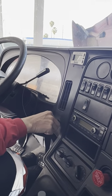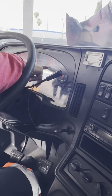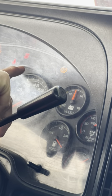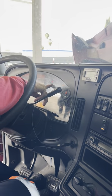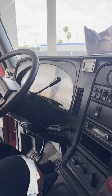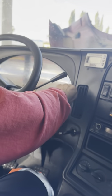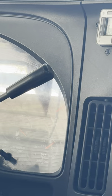To read my air gauges, I have to put my truck into the ON position. You take the key and put the truck in the ON position. On the panel, my ABS light — the little round one — is on. My ABS light just went off, which indicates my ABS system is working properly. At this time, my air gauge is reading at 100 PSI. I have to be below 80 to continue with the safe start, so I'm going to fan my brakes to get below 80 PSI.